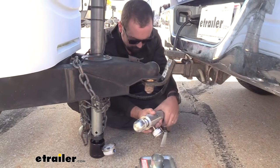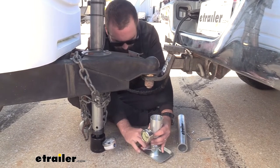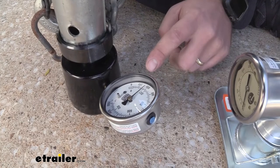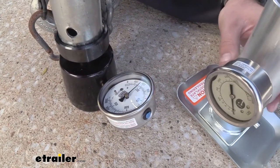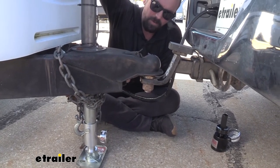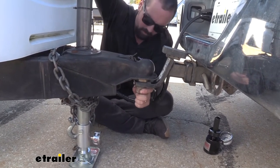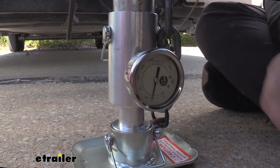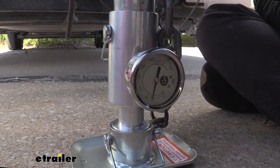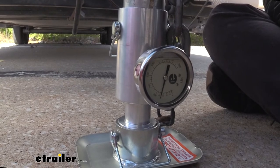It's just a simple two pins — pull this out. You're going to see where our coupler mount was; that's simply going to sit in here. We put our pins back and then we're ready to measure it off the jack itself. Right now we're looking at 375 pounds as our tongue weight off the jack. Now with it attached to the jack, the best way to make sure your measurement is proper is to lower this down until you know it's uncoupled and the vehicle's not supporting any weight. With this wobbling around, we've found our tongue weight — and as you can see, with our tongue weight supported by the jack itself, we're reading right about the same measurement. Many of our customers have tested these out at CAT certified scales and found them extremely accurate, within a two to three percent difference — which is pretty spot on.